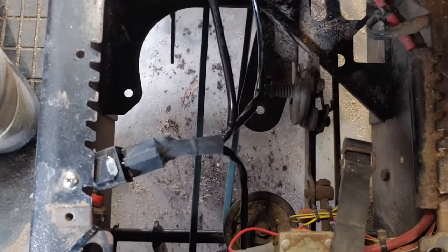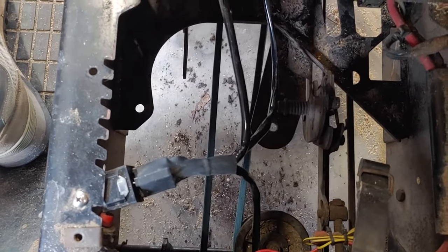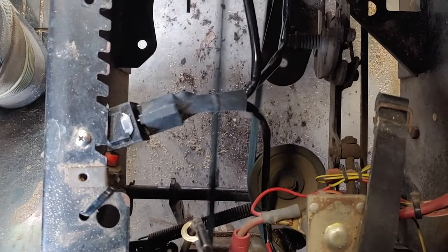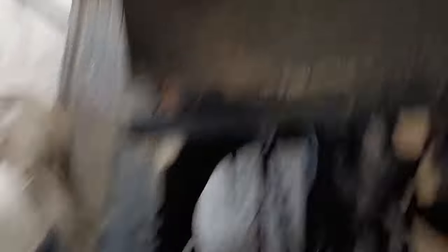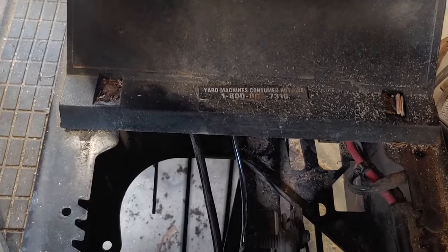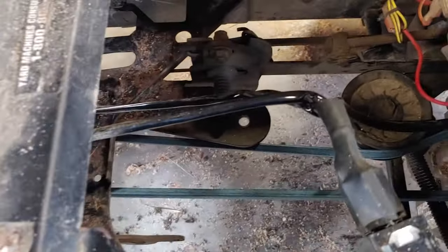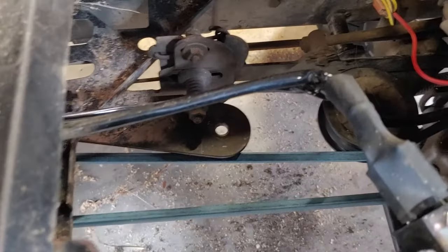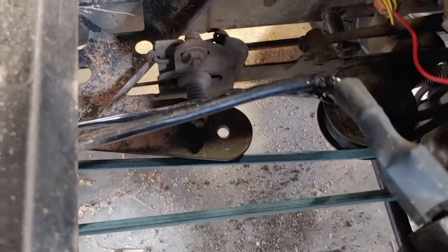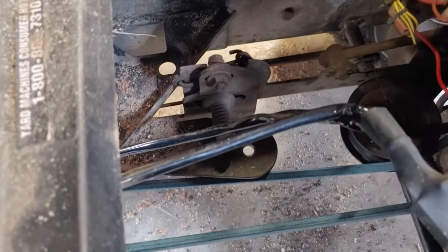After all that, I went to start it and the battery was dead, so I had to take another step back and charge the battery. After charging it, it's turning but not quite turning over... there we go. I got the drive belt put back together. I actually took out that other idler pulley because a 75-inch belt is a little too tight straight from the store — the battery was struggling to turn it over. With that pulley removed, it works out fine.